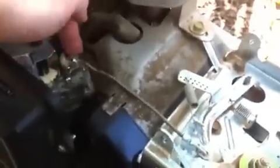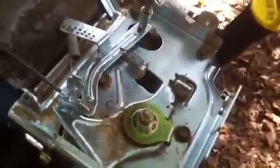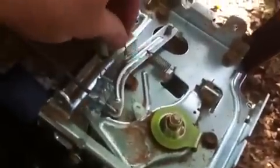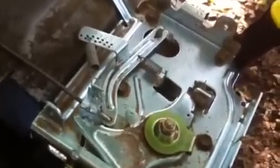With the throttle in the fully open position, I want to show you: when I'm putting this thing in the fully open position — here it's closed, here it's open — you see this is my governor arm. Is it going clockwise or counterclockwise when I put it in the open position? Here's the open position — it's going counterclockwise. A lot of governors go clockwise when going into the open position, but on mine it's going counterclockwise. So that's the way you turn the shaft — you turn it counterclockwise, not clockwise. It's just whatever way the governor arm is going when you go to the open position, that's the way the shaft goes when you turn it.